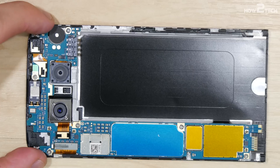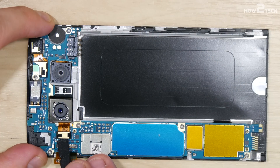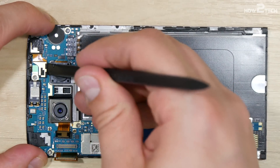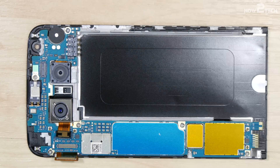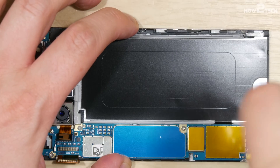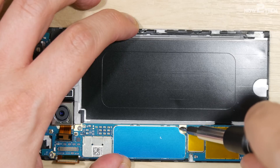So now let's go ahead and start taking apart the phone. We're going to take up all the little cable connectors here. This one's for the display itself. This one's for the rear-facing camera — one of them. This is for the front-facing camera — popped right off. Now we can go ahead and start to remove the screws holding the logic board in. All these silver screws will have to come out of the midframe.